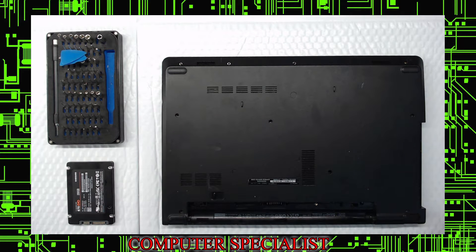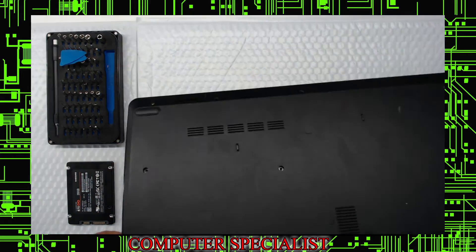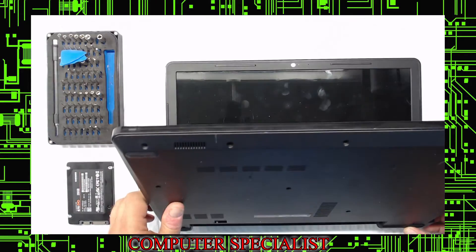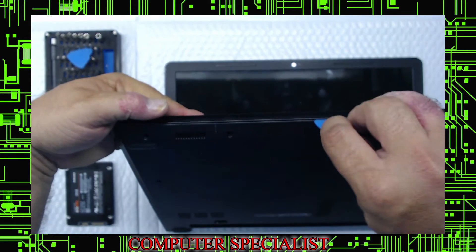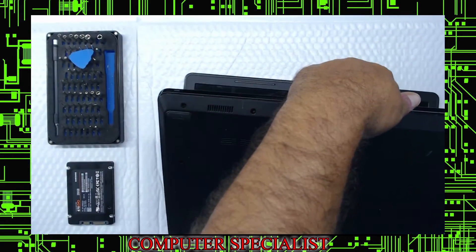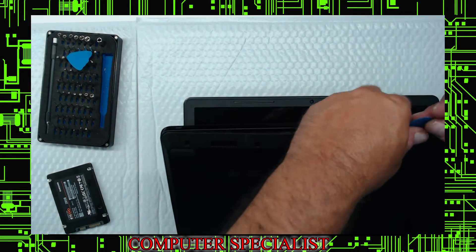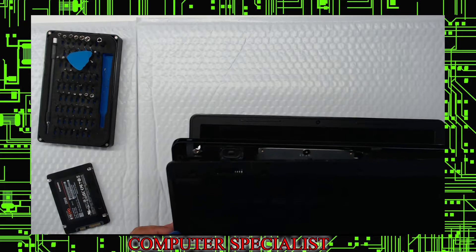Here's where it gets a little tricky, especially with this model and some HPs. These two screws hold the hinges in, so be careful when you open up the screen — there's not much support left and you don't want to crack out the hinge mounts. Put most of your pressure right here. Get your plastic tool and run along the crack — just keep prying it up. It should come off pretty easy. If it feels like it's not coming off, first thing to check is the screws.